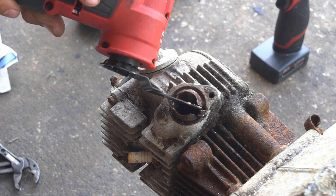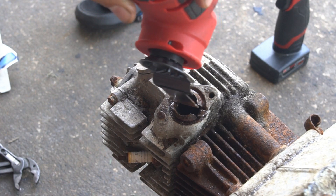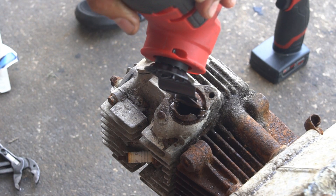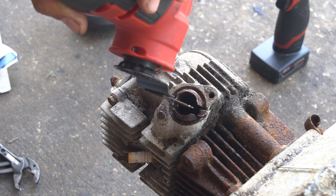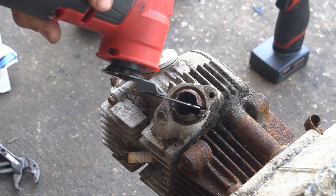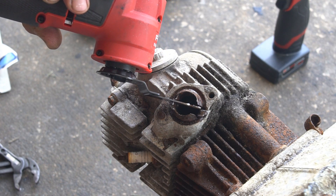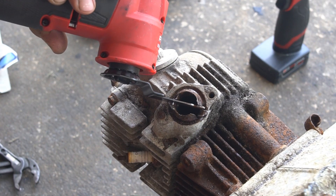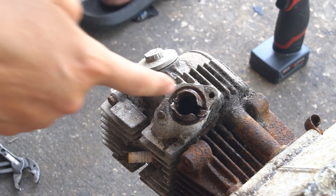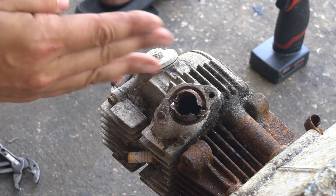So I'm just going to do it. As you start — as you plunge it — make some slits, get some clearance, and you can start going down. It works to start changing your angle of approach to try and rotate it kind of towards the wall of the exhaust port instead of plunging straight down. That helps you get deeper into the stock piece of pipe and start spreading it.